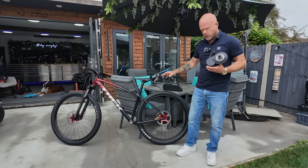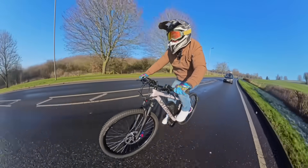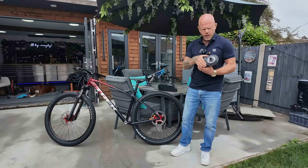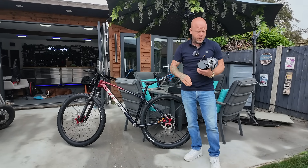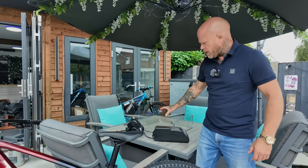Now depending on your gearing you're still going to get 35-40 miles an hour out of this if you're putting it on a mountain bike. A lot depends on your gear cassette and the amount of teeth you've got on your cassette. I managed to get 40 miles an hour out of this last time with a bit of downhill assistance. Really, really good kit - I really like this. The price on this is actually one of the best bang-for-buck kits you can get on the market. It's easy to fit, it works well, really good quality. This is by Tongsheng and I get this through kirbybike.com. There's an exclusive discount code for subscribers - I'll put that in the video description - get 30 pounds off the kit. Very good value for money.